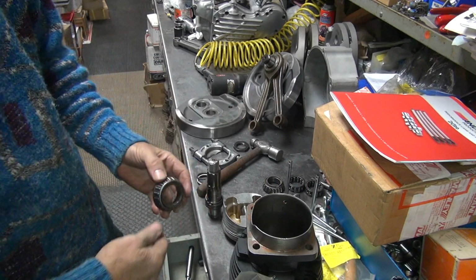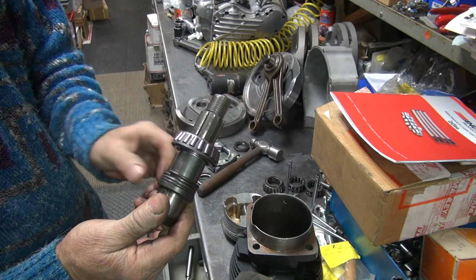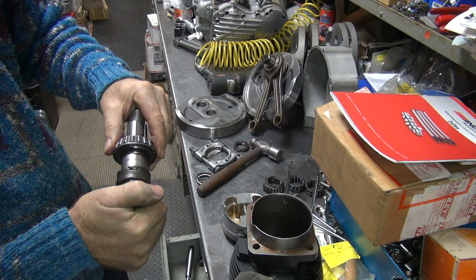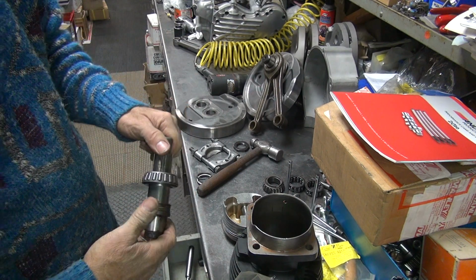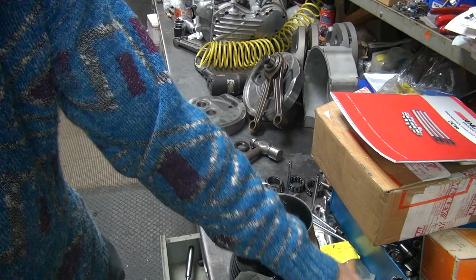We push the bearing back together onto the crank here, and we will have what we want. I'll have to do another mock-up and see if the crank's too wide to go in the case. It probably will be. I'm not sure. So either way, that's 400 and something, 60 thousandths. It's a good number to go with for now.